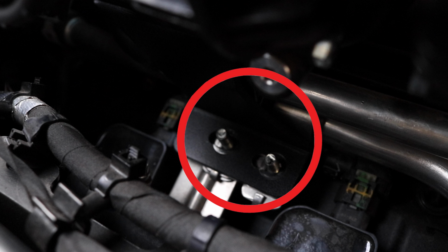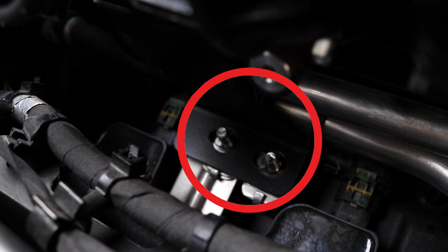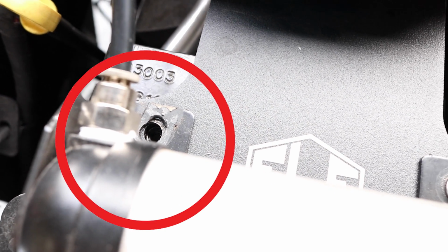The Z bracket lines up with the 2 screws on the heater hose lines that we removed the nuts from earlier. The hole on the plate and the manifold that we did not put any screws in lines up with the hole that is right where we took off that 6mm stud that was sticking up.